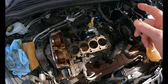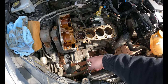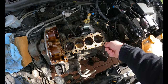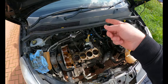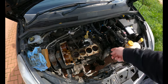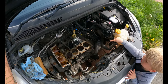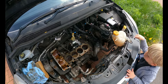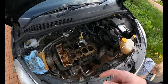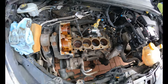So yeah, sorry, we're going to get the starter motor off, disconnect everything, disconnect the aircon pump, get the engine crane on it, get this out, take the flywheel off, fit that to our new engine, and then I'll fit a new clutch while it's out, unless the one in there is pretty much brand new. That's to protect where the fuel comes through, George, just to make sure nothing drips out. Once that's done, we will then do a service on the new engine.